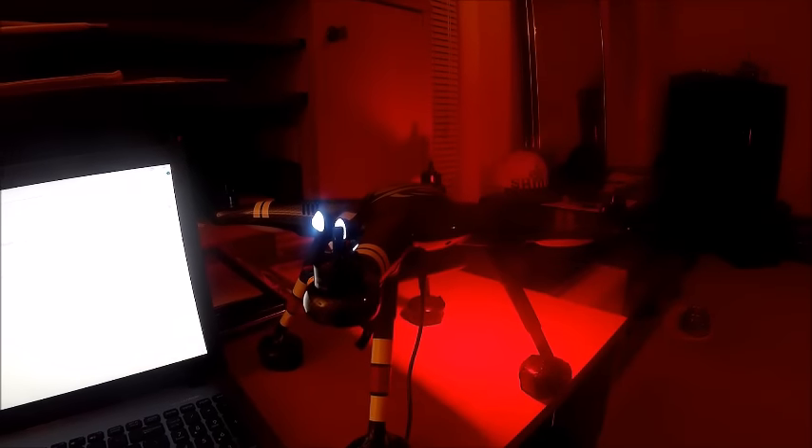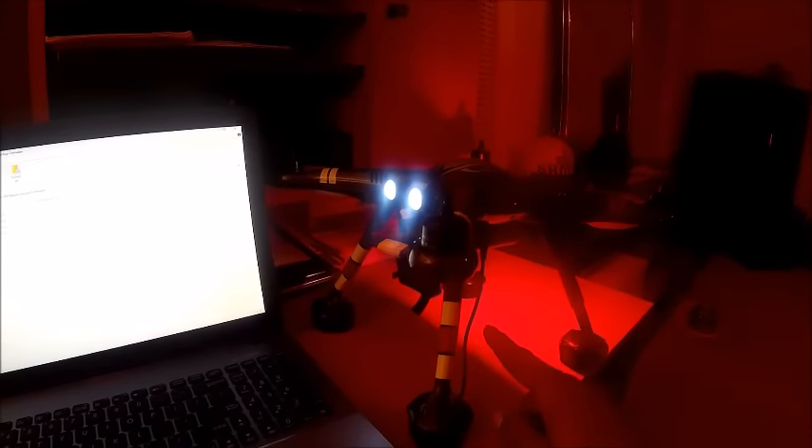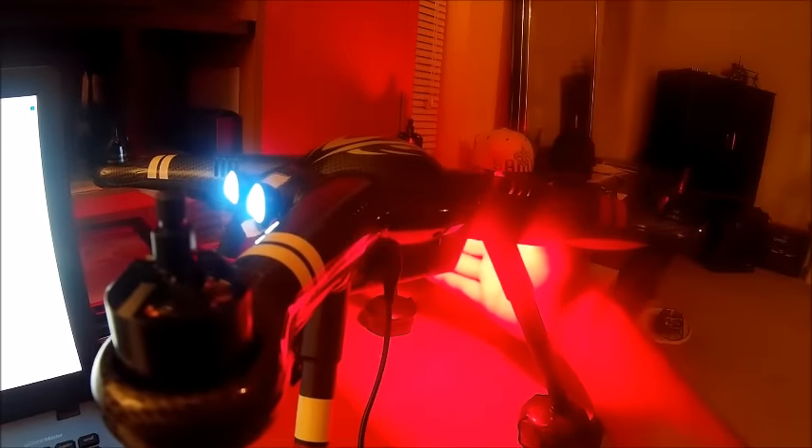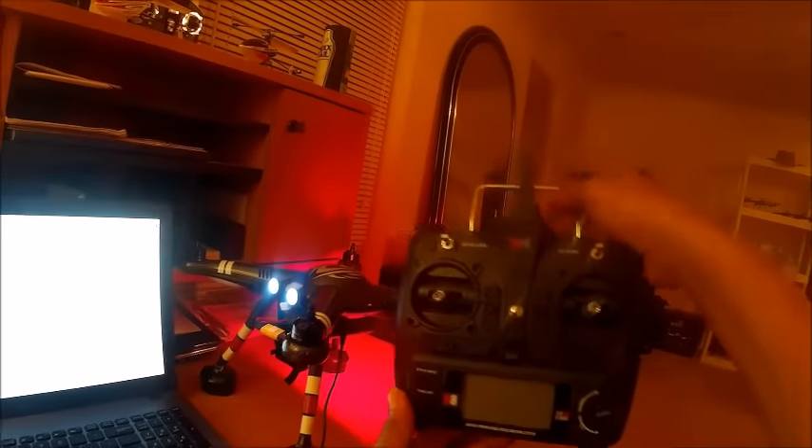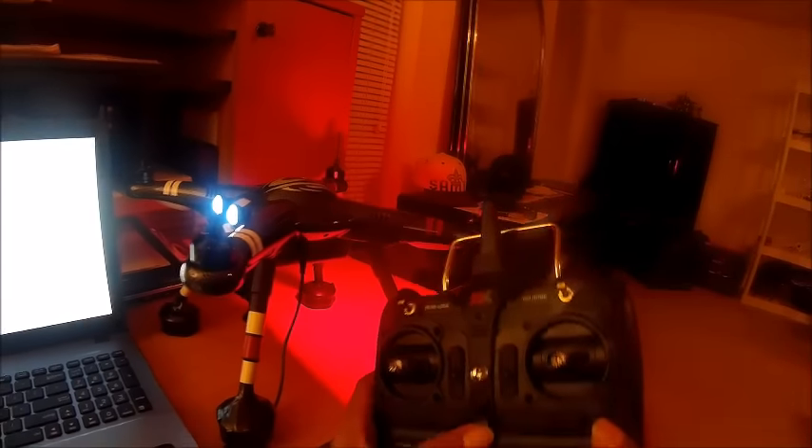After you've pasted those five files into the X380's drive, simply unplug the USB port with the battery still in. The computer gave a confirmation that it disconnected. The X380 is saving those files to its memory and has now gone back to normal. The flight indicator is solid red — that's normal because the transmitter is not on. The beeping stopped, the lights stopped flashing. When I turn the transmitter on, the X380 is back in normal flight mode with satellites acquired and green-green flashing.